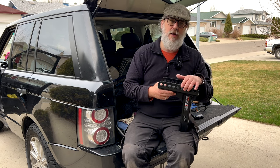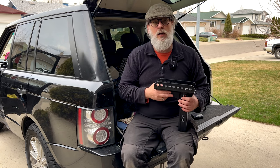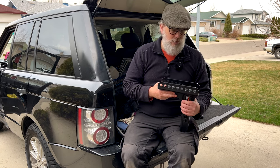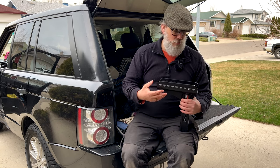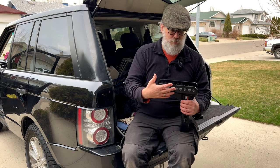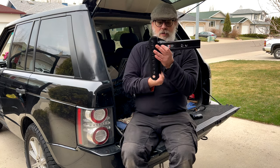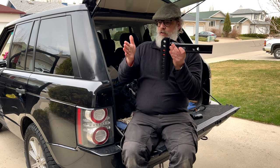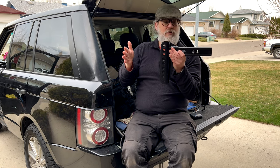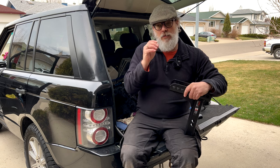I have this receiver so I can mount the pintle hitch and swap it out quickly by just taking the pins out, rather than unbolting a bunch of bolts. But this is a lot longer than it needs to be — it's the only one that does what I need, like a Dixon Bate style. What I'll do is chop off the bottom three or four holes so it doesn't dig into the ground. The pintle hitch comes out a good foot from the mounting point.